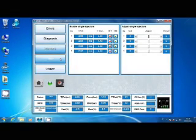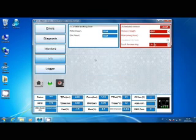Another new feature is the ECU lock for service. You can find it here in info. First of all, you have to set a scheduled service, for example 300 hours. Usually when enabling scheduled service, you simply make the switch beep at every vehicle start when the selected service hours are expired.